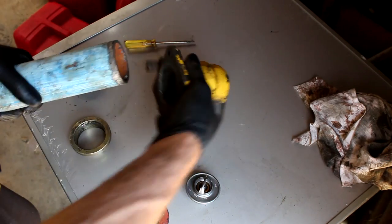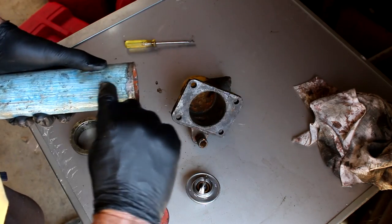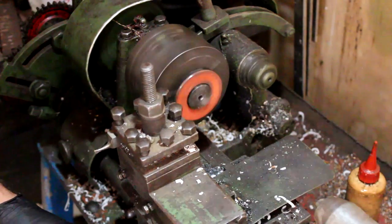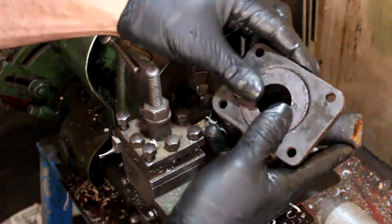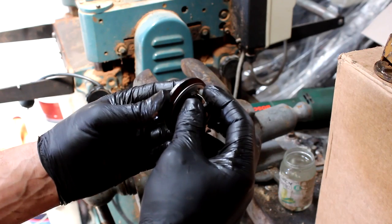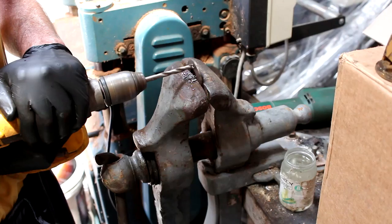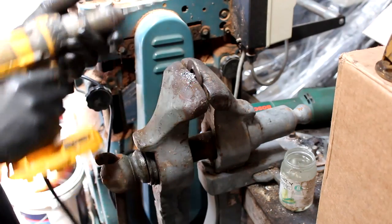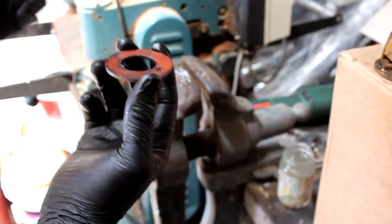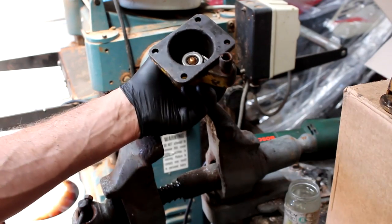I found a piece of pipe which is just slightly bigger than the housing, so I'll use that as the sleeve above the thermostat — I'll just have to cut a wee slot on it and skim that point off. I'm going to drill a little hole in this washer just so the valve can do its thing, because it can't really open up with the washer there. A little valve fits in there alright now. So I'll push this into the housing. That fits in there quite nicely now, so I'll cut a bit of pipe the right length and press it in there.